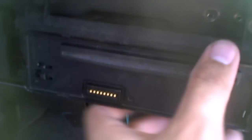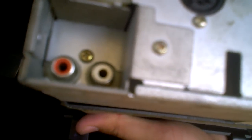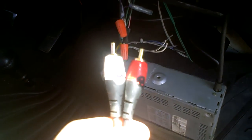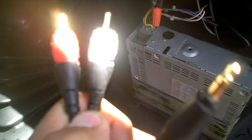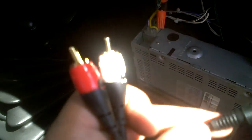What you do is open it, unscrew the frame — whatever is holding your car stereo — and if you look in the back, there are two holes: a red and a white, which I believe are audio inputs. Go to any audio store and get a specific cable to connect your iPod. Make sure one end has red and white connectors and the other end goes straight to your iPod's auxiliary port, so it converts the red and white audio inputs to auxiliary.